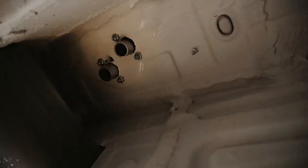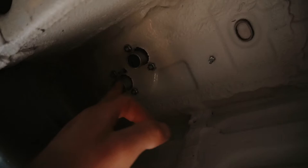Okay, as you can see, heater is mounted, so I drilled the holes. For the bigger exhaust holes, inlet and exhaust, I did a 1 1/8 hole saw. And then I just drilled the holes for the bolts and for the fuel line. As you can see, obviously it's painted, I painted it before, just to make sure. But the fuel line is accessible, and these are accessible as well. So, now that's bolted, now it's time to start working on the wiring.